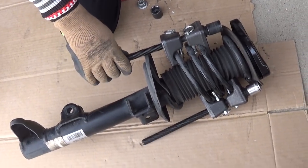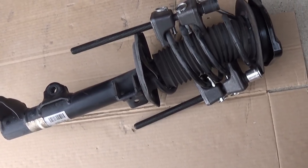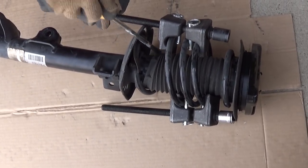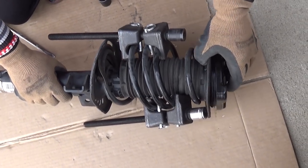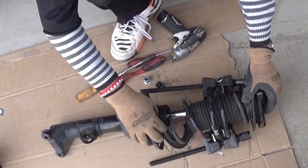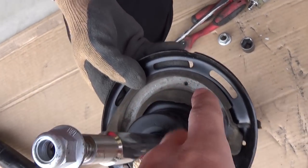Now it's important to be very, very careful again. You can see the spring is stuck in the rubber a little bit. We need to unhook the rubber there because it gets stuck, so we cannot pull up — and the dust doesn't go into the shock, that's why it's designed that way. Next, we can go ahead and pull it out — it's holding a little bit. Eventually it gets loose and comes out. You can see this is the spring assembly; this is the strut.